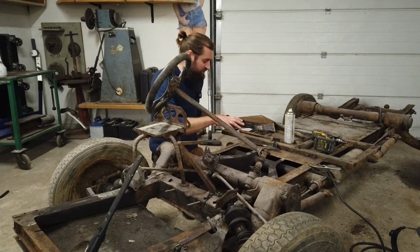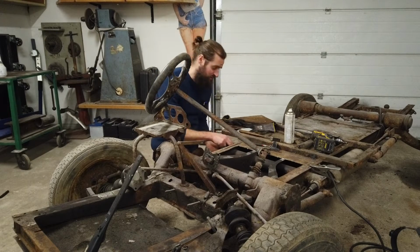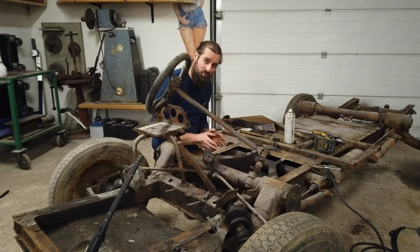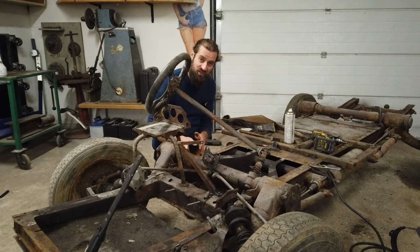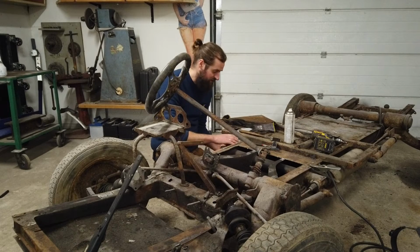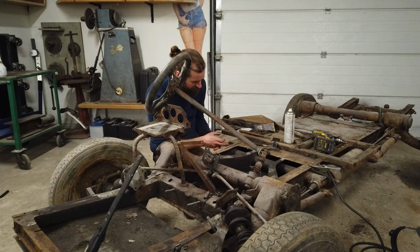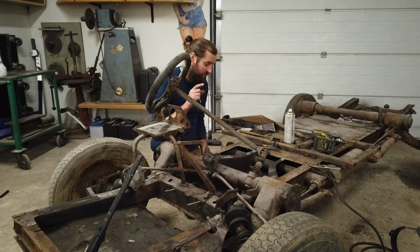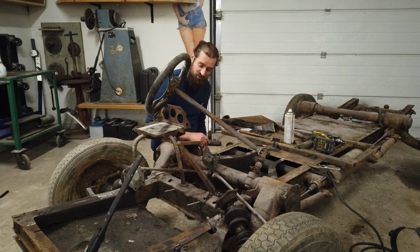While working on this, I noticed that the suspension pot up here got some damage and some rust, and the bushing is completely gone. So I have decided that it would be wise to take them off, change the rubbers and the connections. They are rather difficult to get off, but also I would like to change the kingpin and maybe weld a new cap into the suspension cylinder if needed. I can't really see if it's necessary just yet, but I will check that out. But another thing, it will make it possible to clean and paint the chassis underneath the suspension unit.